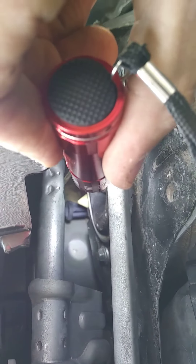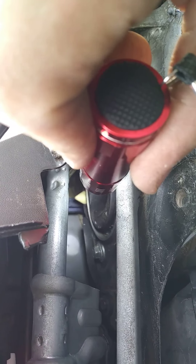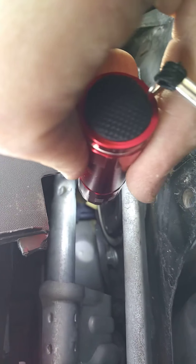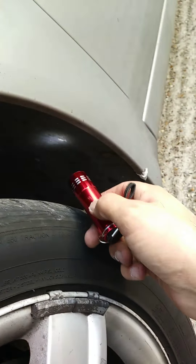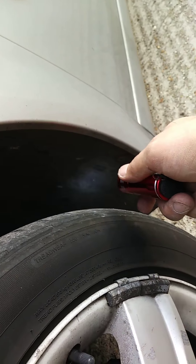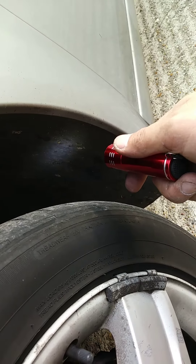You can see that black thing there — that's the drainage for the dashboard. Sometimes it gets blocked up. It's designed like a drain. If you have any water going into the footwell, it's good to clean it out. There's one on the other side as well. You can use WD-40 if it's heavily blocked, or put curtain wire through there. It comes out the other end from under the wheel arch — remove the plug, pull it out, and run the curtain wire through to make sure the WD-40 is dripping out and it's not blocked anymore.